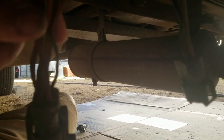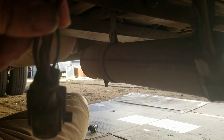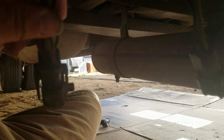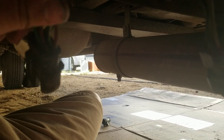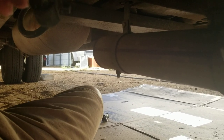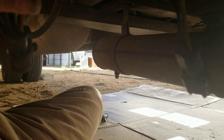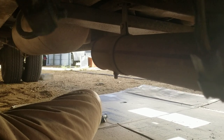If there's anybody out there that has an E-4OD Ford transmission on whatever power plant you have, the problem I'm having is at low speeds it wants to shift up, shift down, shift up, shift down — just like it doesn't know where it's supposed to be going. It shifts a little hard when I jump on it and get it up on the highway, but other than that it's okay. But just cruising 10 to 15 miles an hour, like going through a parking lot or going real slow, is where I seem to have the most of my problems.